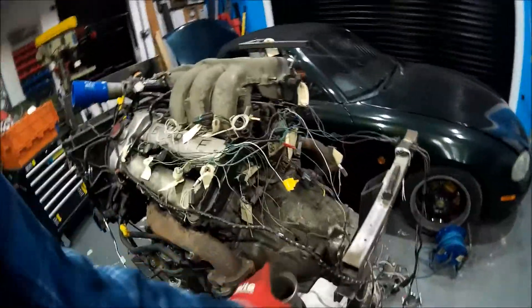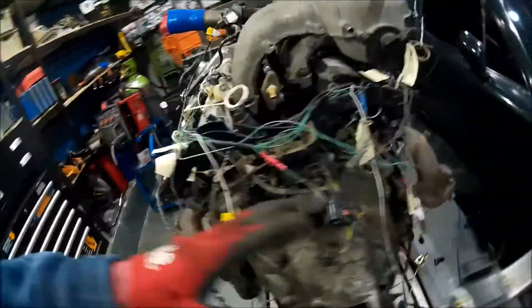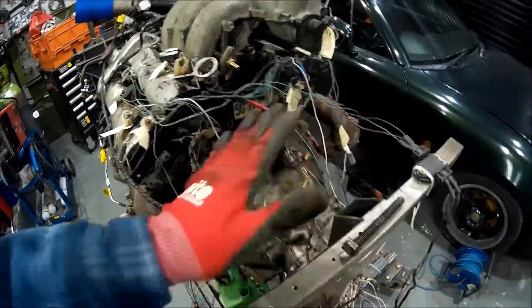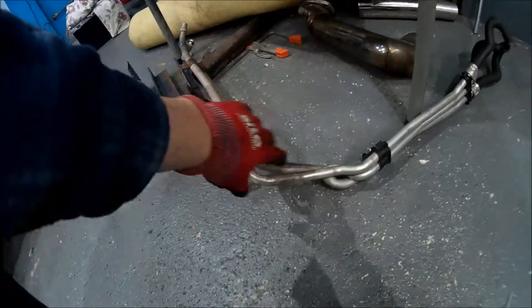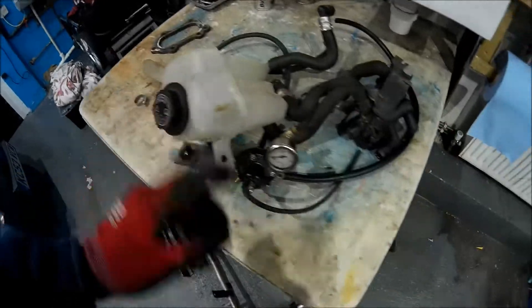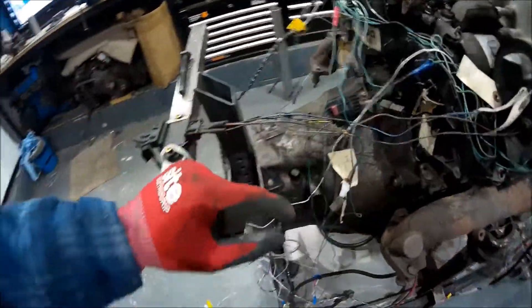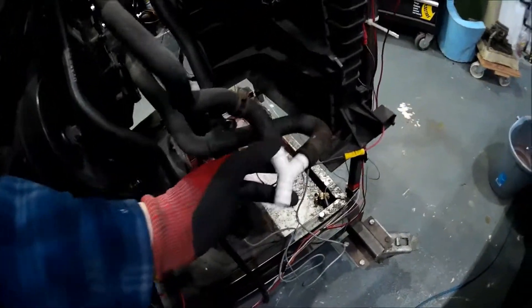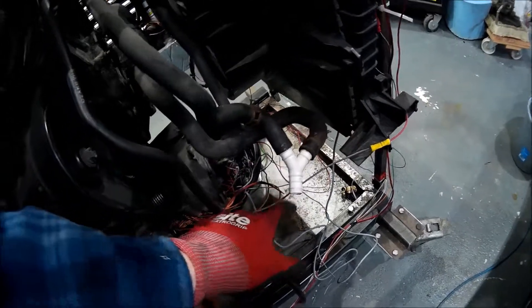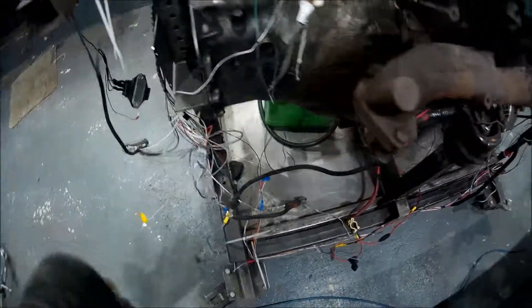On the engine, I've just pulled some stuff out of the way. If you look back to the previous video, there were loads of tubes and wires everywhere. Because there's going to be some exhaust pipes and a lot of heat, I've tied it all up and got it out of the way. These were the coolant pipes going to the car heater — bin those off. The heater valve and the fuel pressure regulator are going to be relocated to the front. The wires I'm going to pull into a single loom, move them up to one side, wrap and protect them from the heat. There's also a coolant bodge I need to clip on properly — that's going to go to the header tank. The coolant system should hopefully still work even though I've kind of rerouted it.